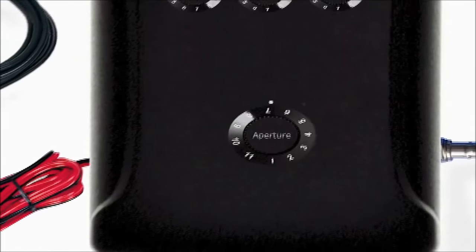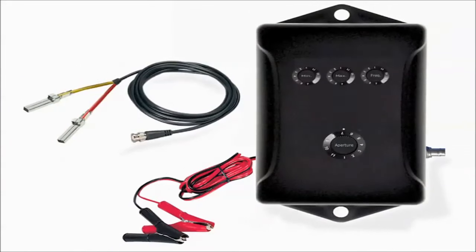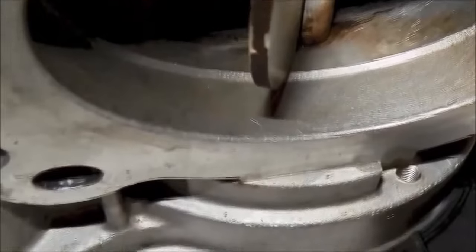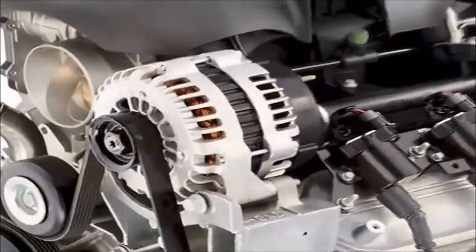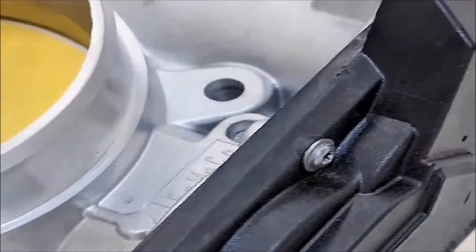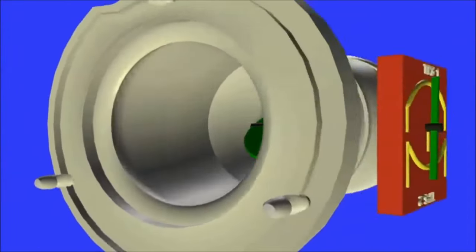In today's throttle control diagnostics, it is important to be able to actuate the throttle for various reasons. We'll go deeper into using this gadget later. But suffice it to say that the drive-by-wire motor actuator controller is used to diagnose the multiple throttle position sensor inputs, to clean the throttle body, to determine if the motor is binding, and to diagnose any of dozens of issues with an electronic throttle actuator system. But first, a word on how the electronic throttle works.